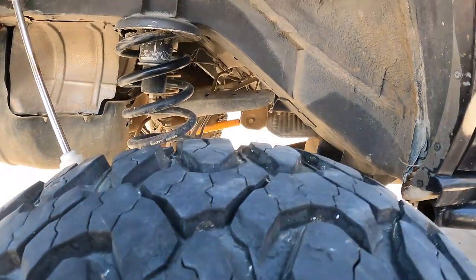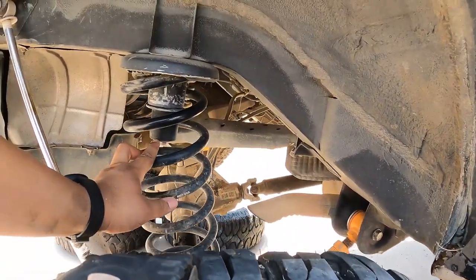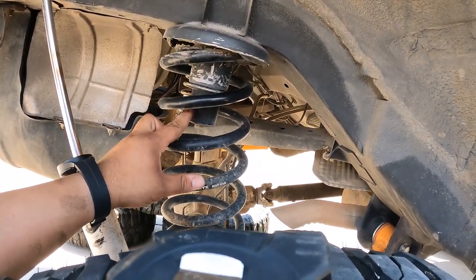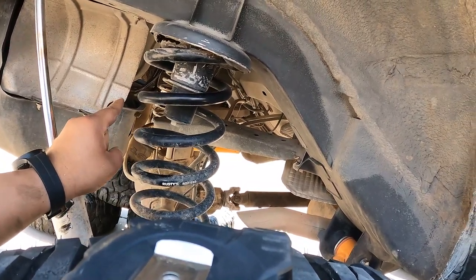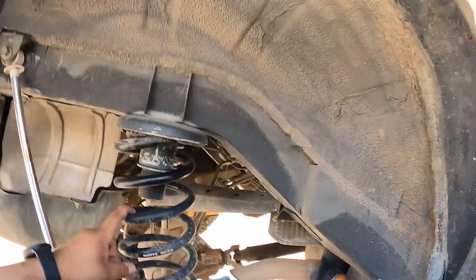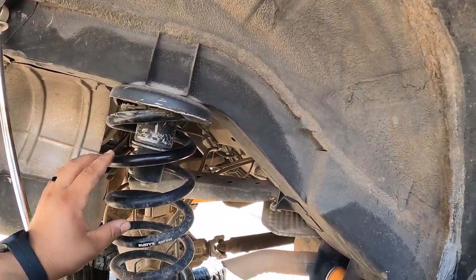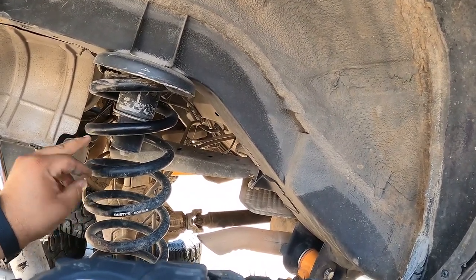So, I like it, guys. Let's see. I thought I was going to have to make a bump stop for it, because I have pipe. I can extend a bump stop here. That's what I thought I was going to have to do, because I thought we were really going to rub on the top fender. And I wasn't going to cut it, so I was going to extend the bump stop, limit a little bit of flex, but avoid trimming. But no, I like it.